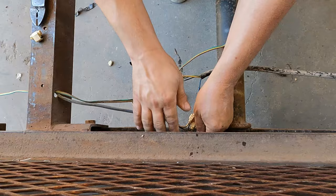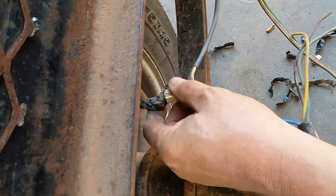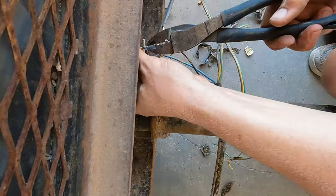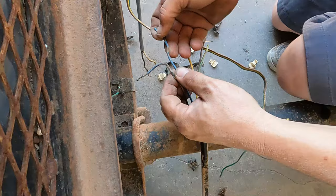As you can see here, if you're going to use scotch clips, be sure to use two to three rolls of cheap electrical tape on them just to complete the process. This would be a good time — it may be helpful to write down your color codes of what was hooked up before. We're going to retest everything anyway, so we're not going to write down the color codes.